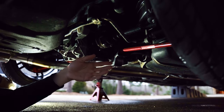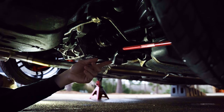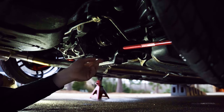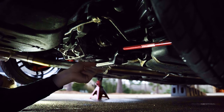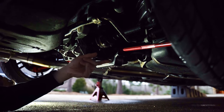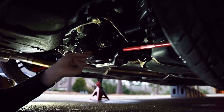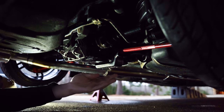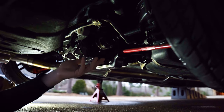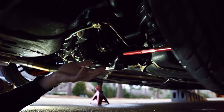So, one thing you should know about these camber arms is that when you get them, they aren't meant to add camber. The Godspeed Project arms specifically are meant for camber correction. So, they will take camber out. They actually are shorter than the OEM arms. So what I did is after I bought them, I realized I made a bit of a mistake because I run 7.5 degrees of camber, so I wanted more.